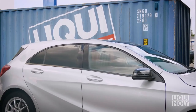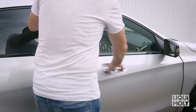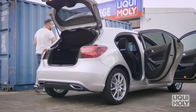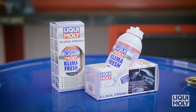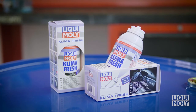Ensure that all windows and doors are closed during the spray and exposure time, and that there is nobody inside the vehicle. As soon as Climate Fresh has stopped spraying, the use is complete. Remove the box including the can, then ensure sufficient airing of the vehicle interior and switch the engine off. Afterwards, with Climate Fresh by Liqui Moly, all unpleasant odors are removed and the interior smells pleasantly fresh again.